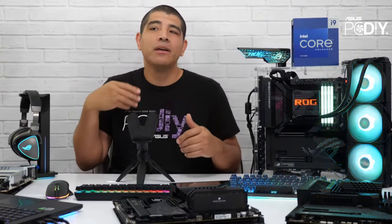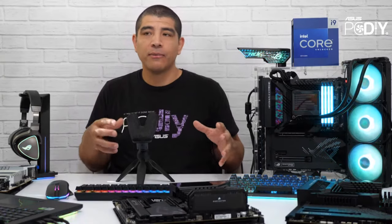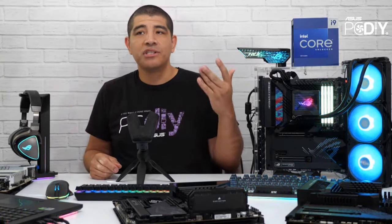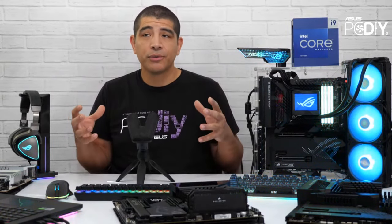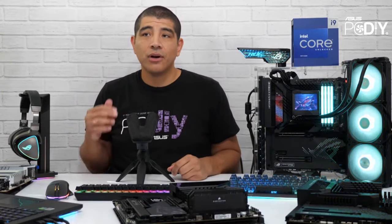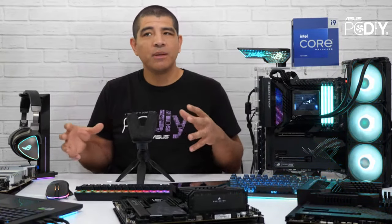So there's not a heavy amount of usage. Storage actually will benefit more generally from more bandwidth, so going from PCI Express Gen 3 to Gen 4 to Gen 5. But even there, you could argue that the bandwidth, while it's nice, is not necessarily super critical because it depends on how you use the drive, right? Most drives aren't using sustained sequential workloads. You're generally just pinging them, so actually IOPS are going to be much more important.